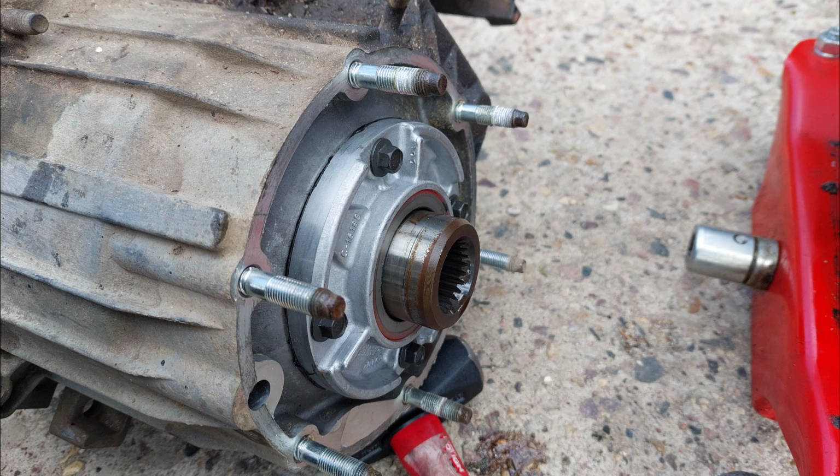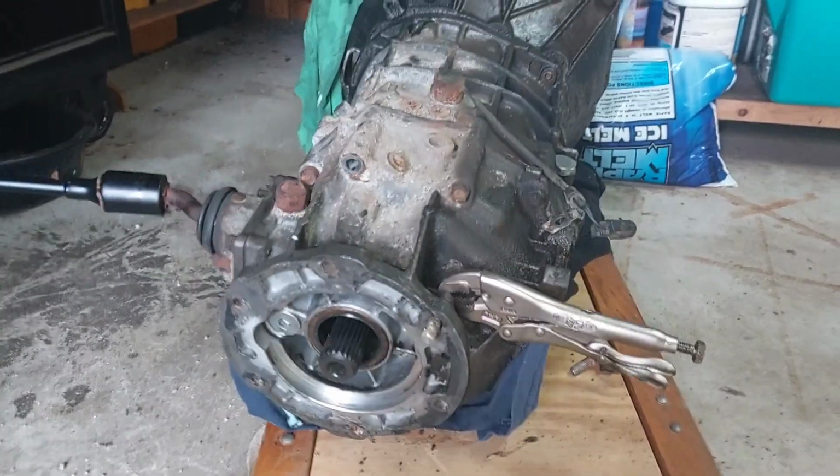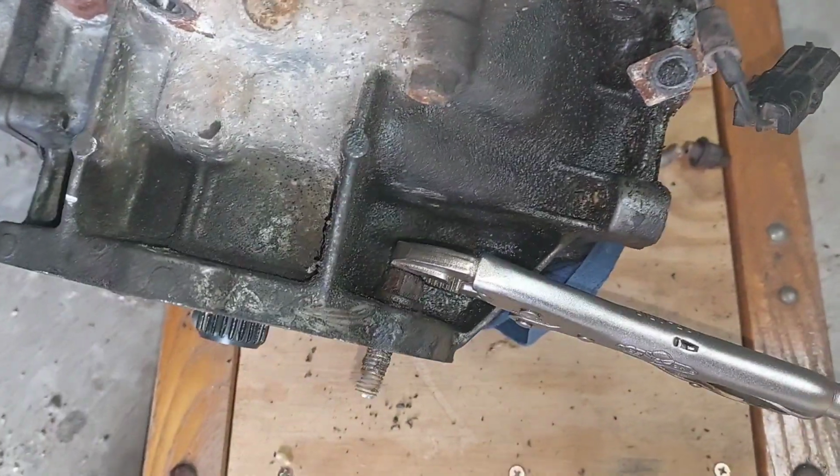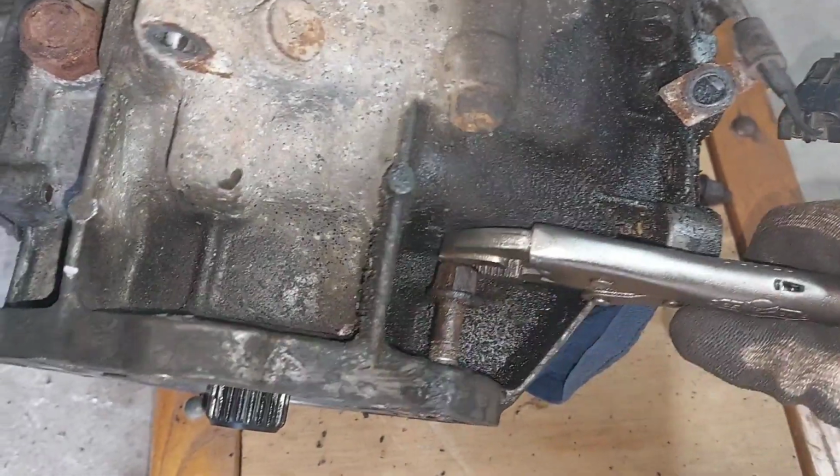For example, most of you are probably using an AX-15. If so, you can 100% use the Automatic's medium length input shaft transfer case with the longer output shaft of the AX-15. It's actually probably better to do this because the splines have more area where they're actually in contact with each other, meaning that connection is technically stronger.